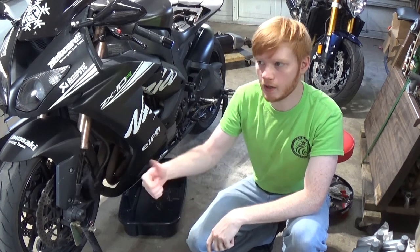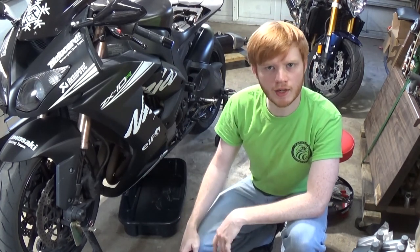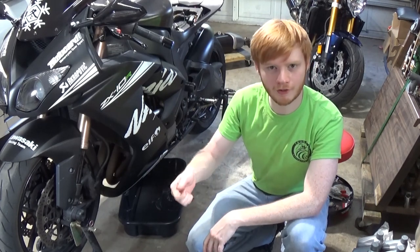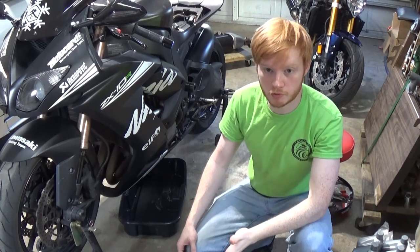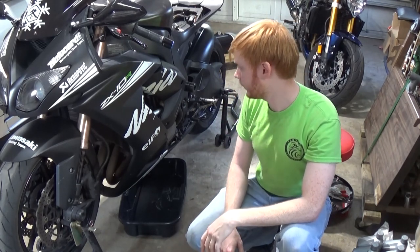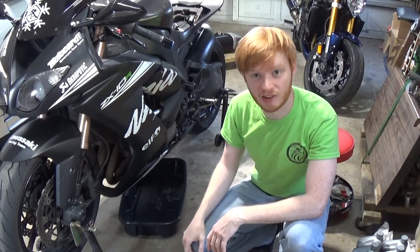And right before I got on it to go somewhere, he asked, is it recharging? I said, well, yeah, it's recharging. I said, well, you know what? Look, turn it on. Turns over just fine. I put my multimeter on it: 12.2 volts. So it wasn't recharging, or if it was recharging, it wasn't enough. So I imagine, and I'm hoping, it's a stator.